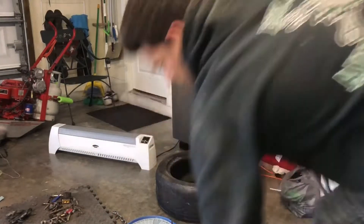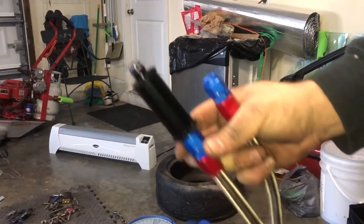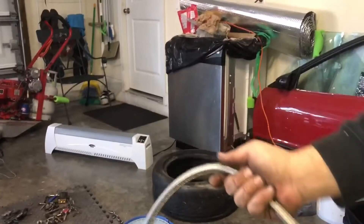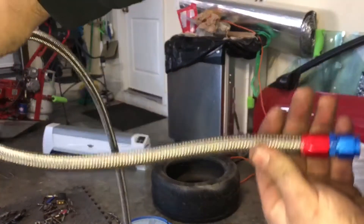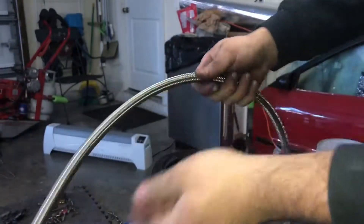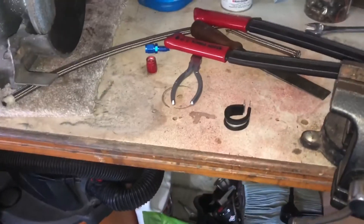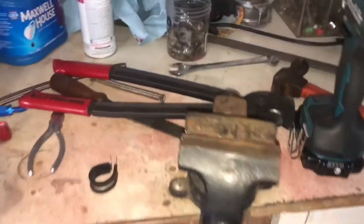So now we've got three fittings on — from the tank to the firewall, to the filter, off of the filter. Now we have to measure again. I think I'm going to put the line back under the car, maybe about a foot long — it'll be from the filter over to the fuel rail itself. We've got everything lined up and we decided we're going to be doing a little bracket off of this bolt right here since it clears the rear bracket very well. We got this little clamp holder thing from Ace, which is just barely big enough to hold the actual fuel filter, but the bolt holes will accept a 10mm but not a 12mm, so we're just going to drill it out and make it big enough.